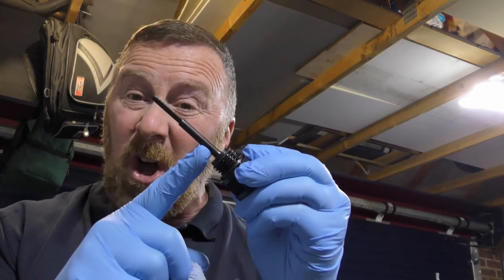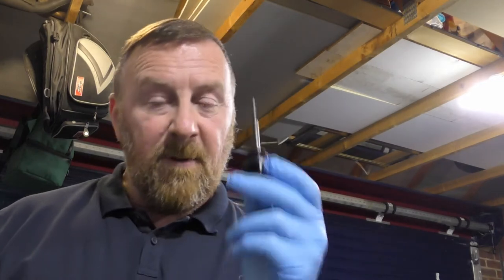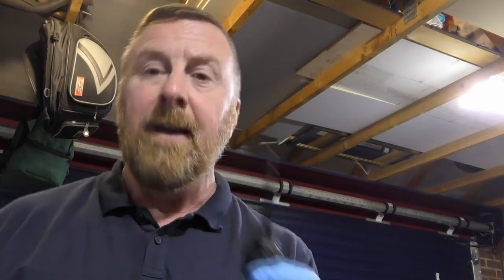This was an inch over the top. I mean, what did the person think it was, 2T? I'm draining that oil out now and I'm going to see how much was in there compared to how much I'm going to refill it properly. So stay with me and find out how much oil this bike actually had in it. I think it's got to be a couple of hundred mils over, but we'll soon see. And I'm just going to put some fresh 10W40 oil in there.